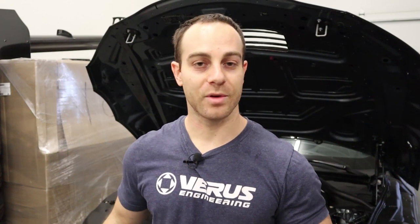We've heard from customers that there is oil coming from the crankcase vent. I don't fully understand how, because the crankcase vent is basically a one-way check valve into the engine, not out of the engine. I've blown on it, I've pulled a vacuum on it, and I can only get the vent valve to vent into the engine. So how people are getting oil out of the engine is not fully understood on my part. That being said, we still came up with a solution.